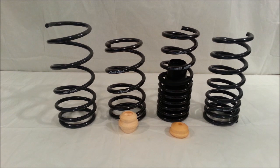Now, you're going to save some money, and you're going to have to cut your bump stops, but honestly, that's not a big deal because on a lot of other vehicles we've had in the shop, Evos, STIs, S2000s, it's pretty common to have a spring kit that comes out where you cut your factory bump stops and reinstall them along with the aftermarket spring at that point.